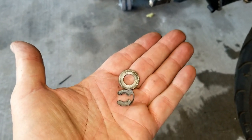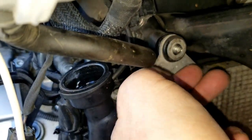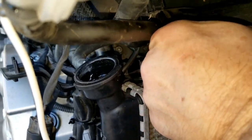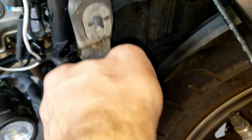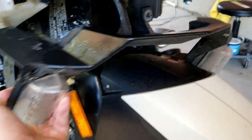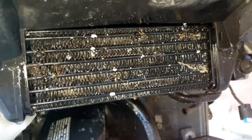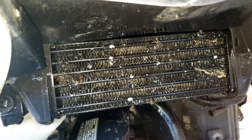The next step is to reinstall the radiator retaining clips - the washer goes on here, then the clip just slides up in here like that. Next is the radiator guard with two screws, and the whole guard comes up and attaches over the top. Before reinstalling the piece with the fog lights, I want to address how dirty the oil cooler is. I've sprayed it with hydrogen peroxide to help dissolve the bug guts, then we'll hit it with Simple Green, then a hose, and that should help.